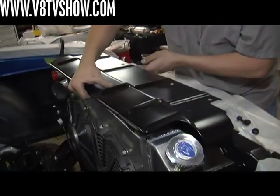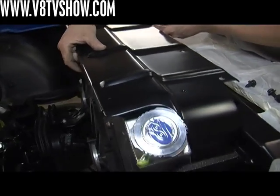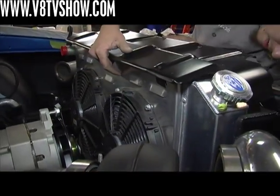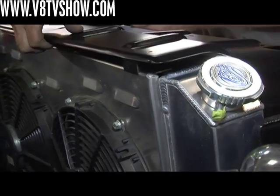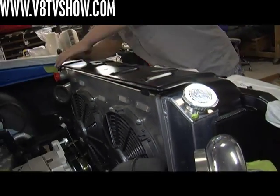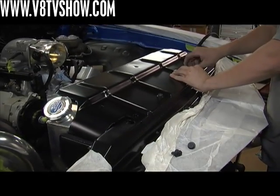We engineered the upper radiator shroud and sides of the core support to funnel the air through the radiator and not around it. We did that by modifying the original Oldsmobile top radiator cover — shortened it and added some curved sides that roll down to manage the airflow, while at the same time it still looks like it might be a stock original piece.